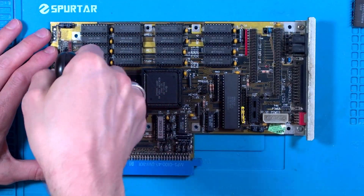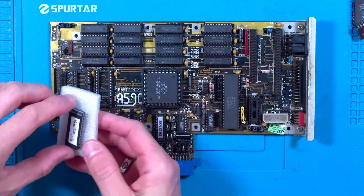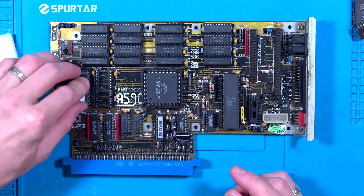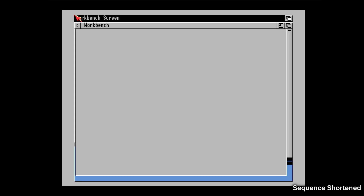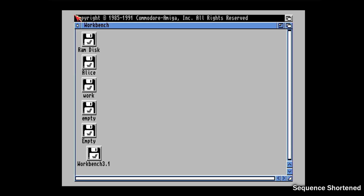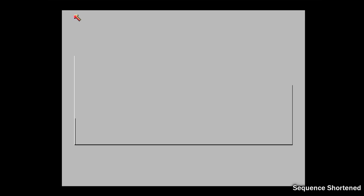And once I've swapped the ROMs I'm going to start by simply booting the workbench disk and see if all the icons appear properly. I'll make sure the autoboot switch is turned on too. I've sped this up but as you can see we finally get to workbench and all the drive icons now appear again. Now there's one more test. I'm going to remove the workbench disk and reboot and see if it attempts to boot from the SCSI hard disk. There's nothing on those disks so I'm assuming it would boot, but hopefully this time without any disk errors.